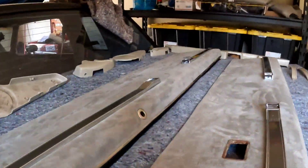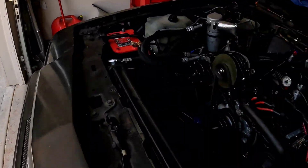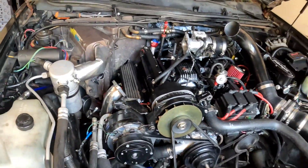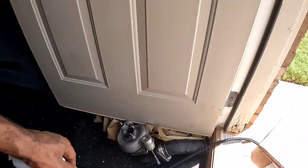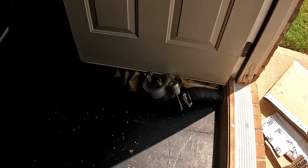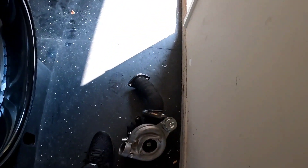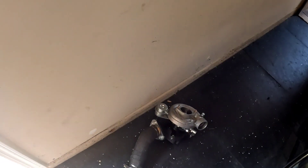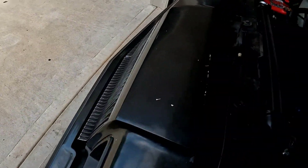Once the fuel injectors get in, I'll put everything together, put that turbo back in, fire it on up, and we're good to go. I'm going to run this turbo for a while since I bought it and haven't fully seen what it can do. If it doesn't do what I want, I'll go to a 58-58 - that's a TA33 - but they also make a 62-62 and 62-64, all for the hot air setup. We'll see what we got going on and then button it back up.